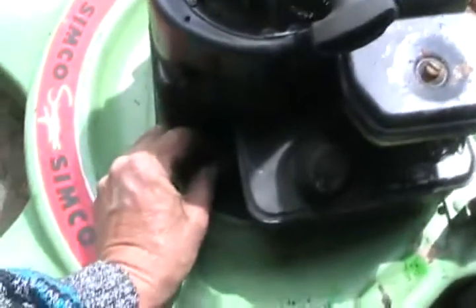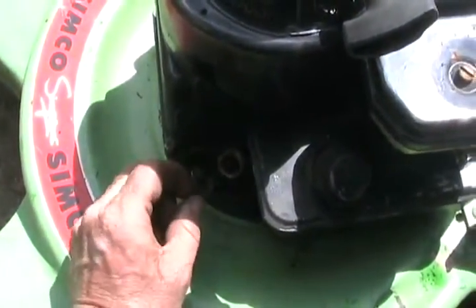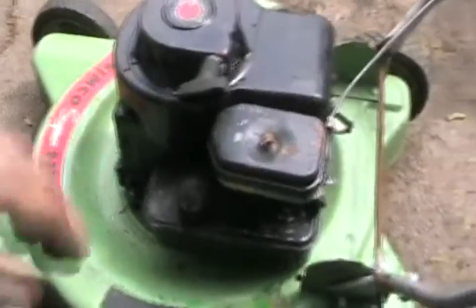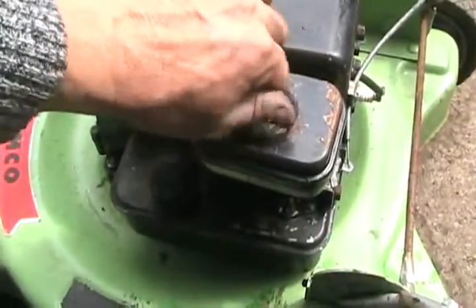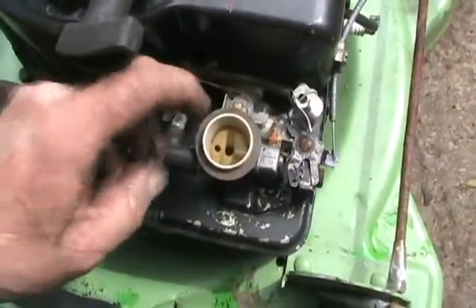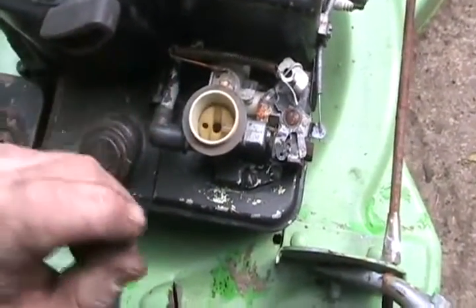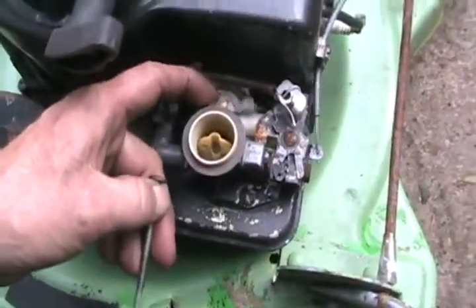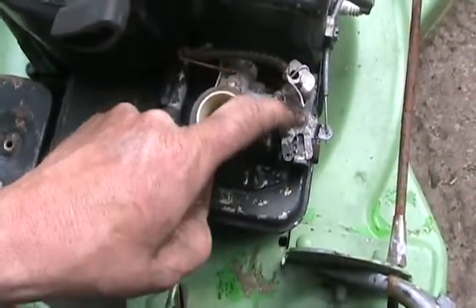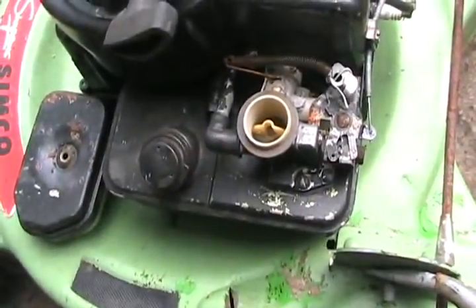Like any old lawnmower, first thing to do is check the oil — and that's quite low. You're supposed to fill all these ones right up till they're at the top, unless of course the cork is halfway up the block. First thing I like to check is the carb setup, and what I see is not good. This is an Choke-A-Matic and that thing should always be closing itself, not opening itself — so that may be the problem. Next thing is governor spring tension, and that's way too loose. So we definitely could have a carb problem — let's take out the gas tank and check the diaphragm, but it's probably bad.